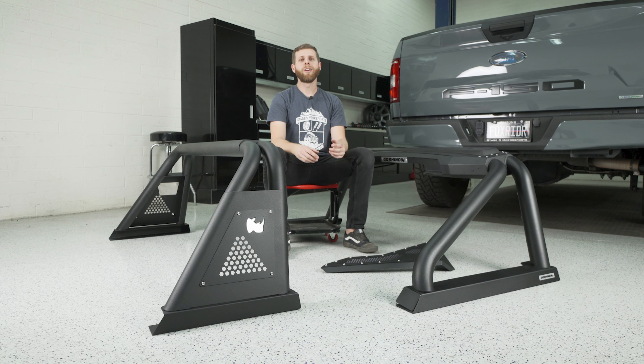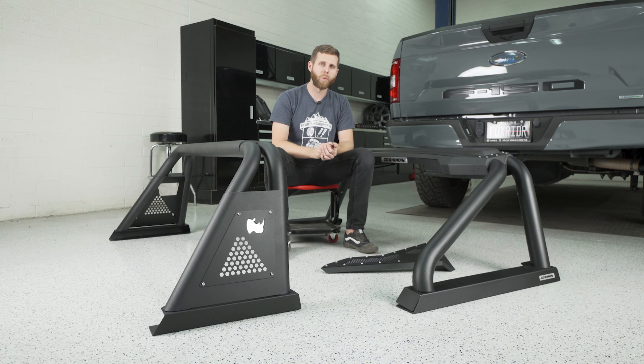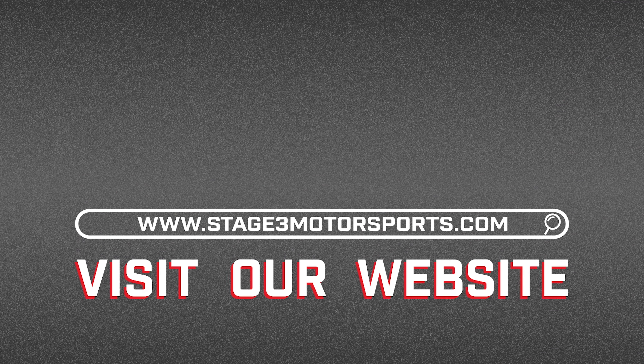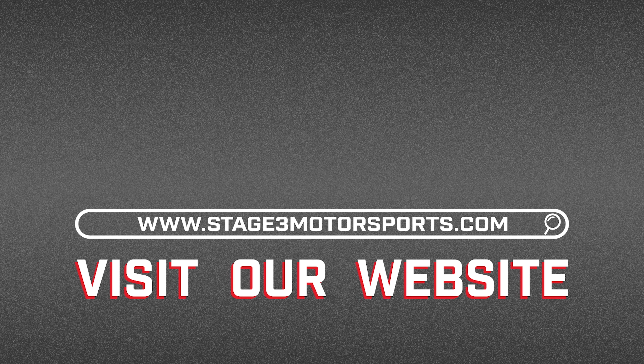So there you have it — that's a wrap on the assembly for the sport bar. A lot of the hardware and the steps are pretty much the same between both of these bars, so neither one is too difficult to put together on the ground. I really do want to reemphasize that when you're doing this install on your truck, you're going to want to test fit it with the bar sitting on the bed and make sure everything lines up, because the fitment can be warped if you tighten it on the ground and then put it up on the vehicle. Hopefully this is a useful comparison so you can select the bar that's going to work best for your vehicle. If you're interested in picking up one of these Go Rhino bars, we'll have some links down in the description. As always, thank you guys for watching and I'll see you next time.